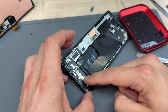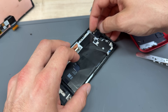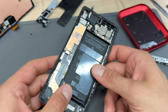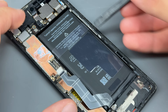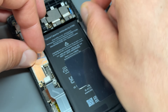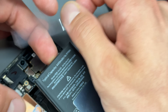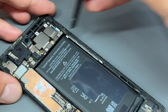Now that we've got all those screws removed, you don't have to remove the screws from the speaker — just lift up from the graphite section and then lift it. There was a bit of tape holding it down, but generally this little shield — well, it's massive — comes away quite easily. Now we have access to the battery connector. Let's disconnect that. These Google Pixels have an absolutely terribly designed battery removal system where you pull backwards and forwards on the tabs — and it actually worked this time.